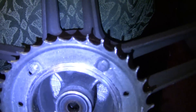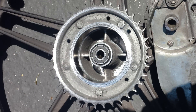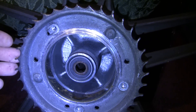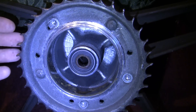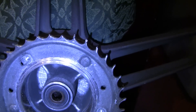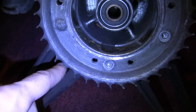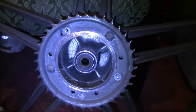So here's our wheel. When your sprockets start to look like chocolate chips, it's absolutely time to replace the sprocket. It looked pretty normal before we left Seattle, and we had been running a tight-ish chain. I didn't think it was that big a deal, but I was thinking in terms of this bike being ridden maybe 10 or 20 miles a day, not 250. These have really gotten worn down, and there's one down here — yeah, this one broke off. It's getting to the point where the sprocket is gonna stop being a sprocket and just become a flat circle, and the chain's not really gonna want to stay on that.